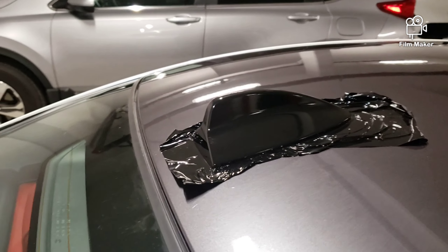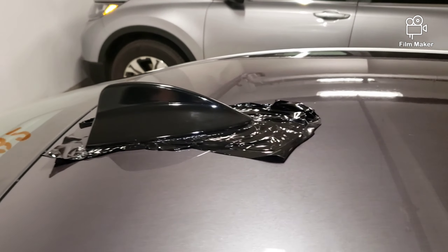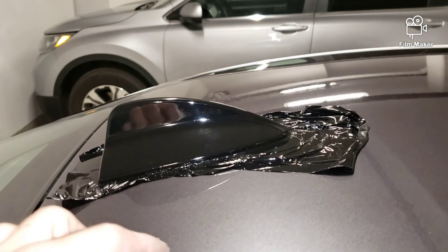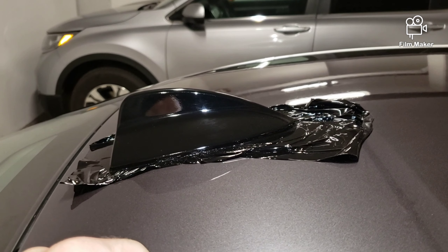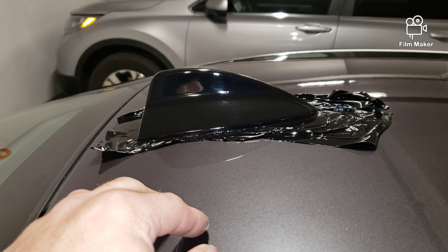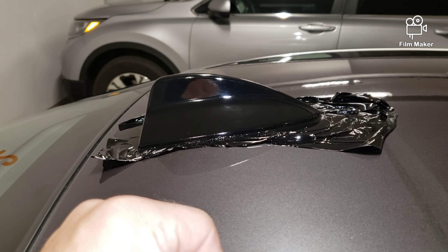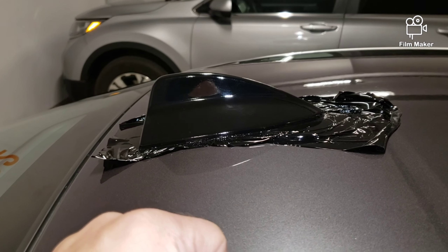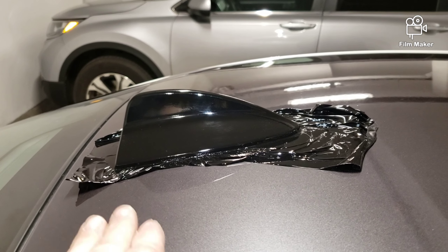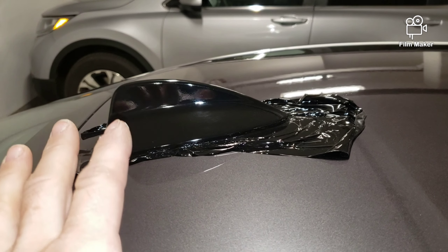This is the best way to do it on the car itself — if you take it off it's a pain to do in your hands. So I just need to trim it. I'm going to lay the vinyl on top with a hole already cut smaller than the size of the aerial so it will slide in but not tear. You cut that with the backing paper on the vinyl so you get a nice neat square and it doesn't tear the wrap when you put it on. Don't forget to post-heat — I've heated it really well afterwards so nothing shrinks.